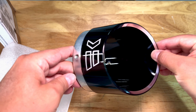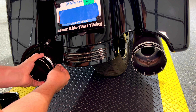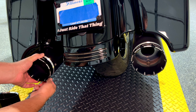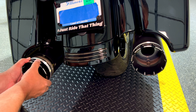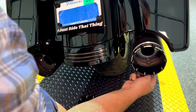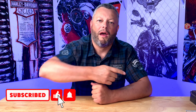So let's go to the bike. I'll pop these two mounting screws and install the tips so you guys can see how awesome it looks. I truly believe this is worth the money. To remove the old tips I'm using an Allen wrench — this is a 5/32 — and you just unbolt the screws: one on the side and one on the bottom. That was super easy, they slide right out.